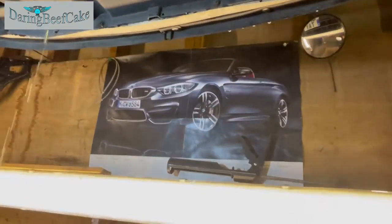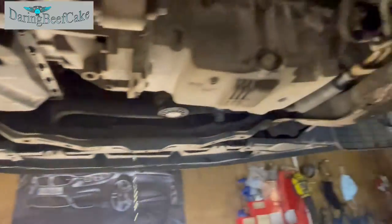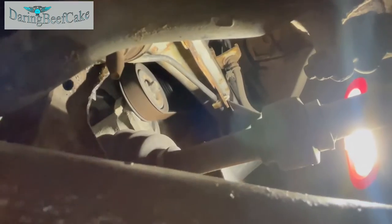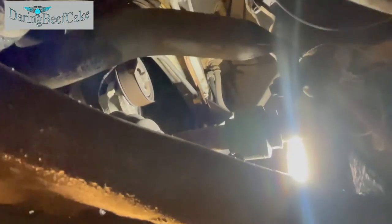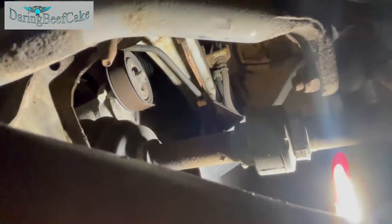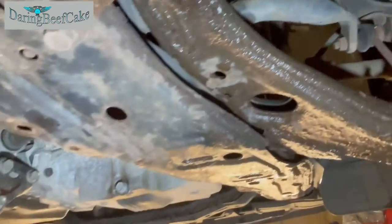And the other thing, just wanted to have a look from here, is the actual tensioner for the belt. So the thing is, on this car, the tensioner is sitting right there. And we need to get that tensioner released a little bit in order to release the belt. So either we need a tool, a long bar. If we do it from the top, we need a long bar to fit the center bolt there, which is a 14 mil. Or somehow we can do it from down here, but I'm not sure. So I'll just have a quick look and see the options, and we'll tackle that belt as well.